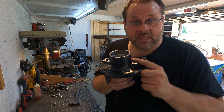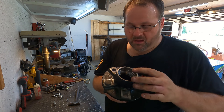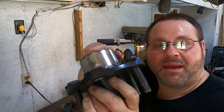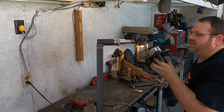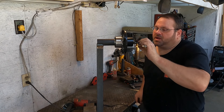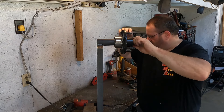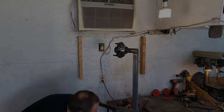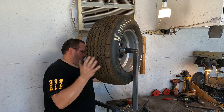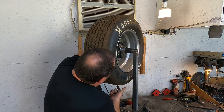The studs are in and done, and this is ready. I'm not going to put the seal in right now because there's going to be a little welding later on this hub. Even though it's cast, we're going to spot some stuff on here, so we'll leave the seal out until all of that's done. We're going to put it together dry — no grease yet. But we'll be able to get a tire mounted up on it and figure out how the motor is going to mount. I took the paint off the back side because that's going to get some spot welds on it.